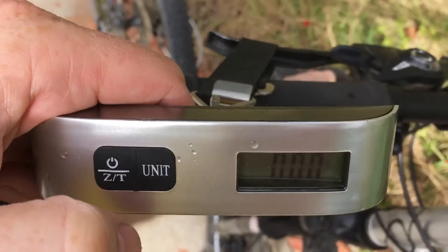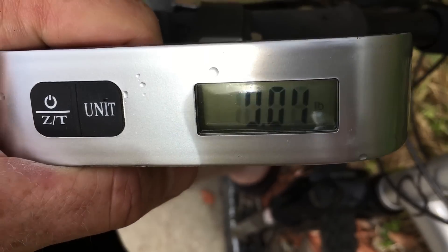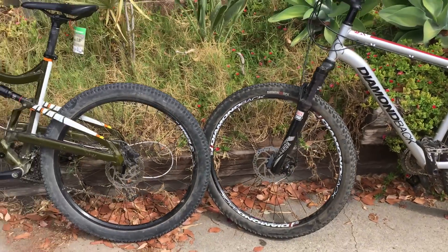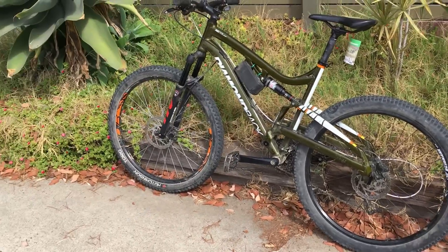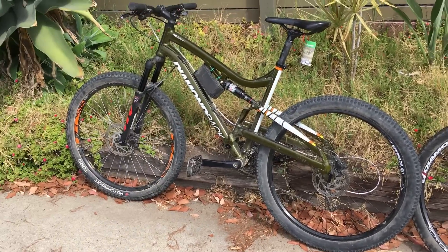On the low-budget hardtail with mechanical brakes, full engagement is at about ten and a half pounds — so that's four and a half pounds more lever effort. Do you feel that at the end of the day? Maybe you get some arm pump with the mechanical, but I imagine you get arm pump on the hydraulic too. If you're hammering down hills all day with a lot of braking, I guess it makes a difference.